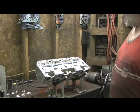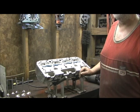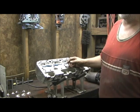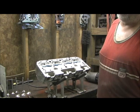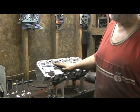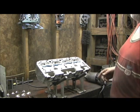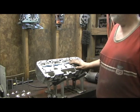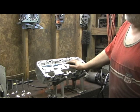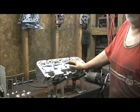The funny thing is the CC volume was almost identical between the two — they were 236 and 237, within one CC. His head had the 250 raised runner and also had the 2.100 valve; mine had 2.080. So he pretty much had two distinct advantages over me, but surprisingly the CFM wasn't that much different.